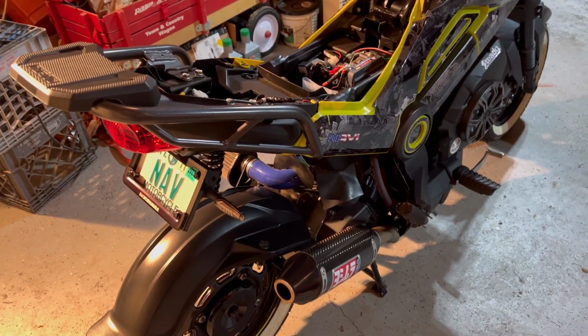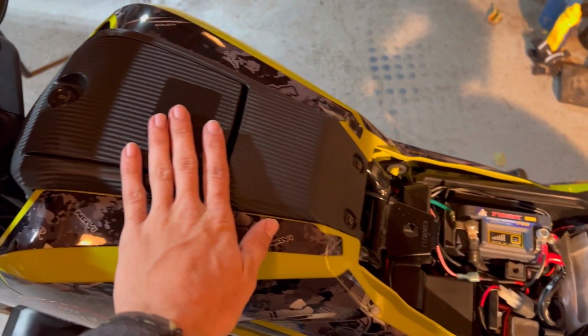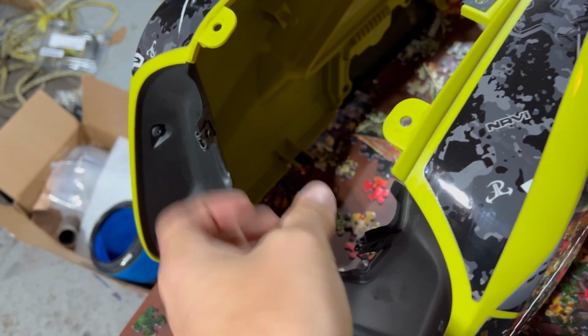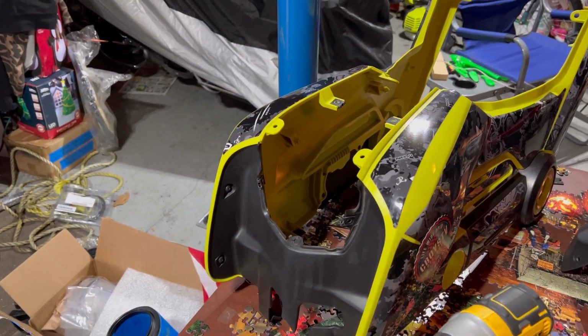Like usual with every single other mod pretty much that we've done to this bike, you're gonna wanna take all three of these top panels off. So that includes both side panels and your gas tank one. You don't actually have to take the side panels off like this attached to the middle section. It is just a pain in the butt having to get these four screws off when you have a steering column right here and your gas tank right here. It's kind of difficult to get a screwdriver in there. So I just take it off, or at least recently I've started whenever I take these two panels off. I just pop the sides because it has the rubber crush rivets, and I just lift the whole thing up. And then you can further disassemble it, which is what we're about to do right now. Again, it is just those four Phillips screwdriver heads, and those will come right off.